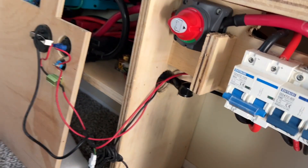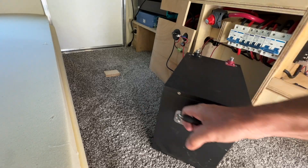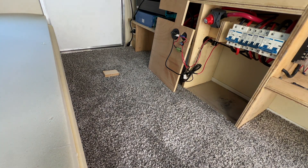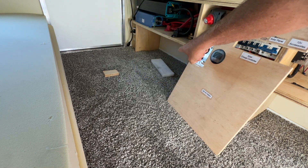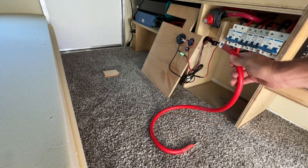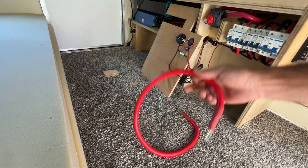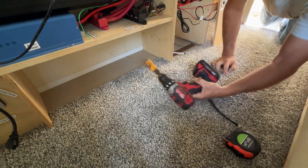We've got the old battery disconnected. We need to do some modifications in here and put the new battery in once we change things up a bit. We're going to set the new battery in the compartment back here — it's going to fit perfectly. We're going to drill a couple of new holes here for the battery cables to go in. We've got two-aught battery cable, three-foot long, which gives us plenty of room to install and easy removal. The compartment will still be sealed up with an access area once everything's done.